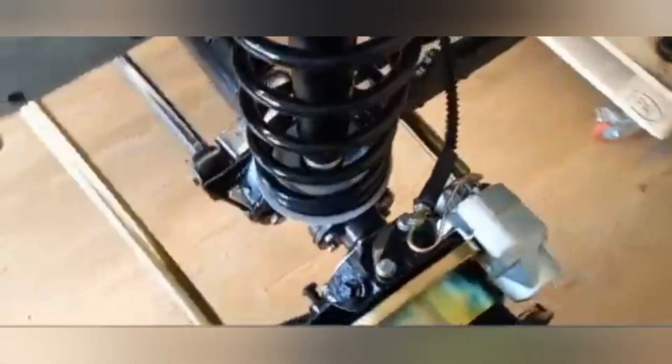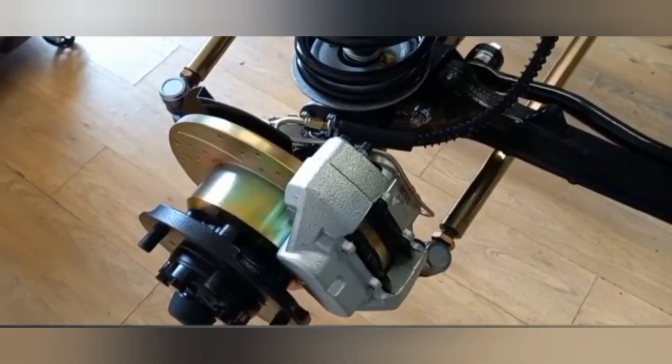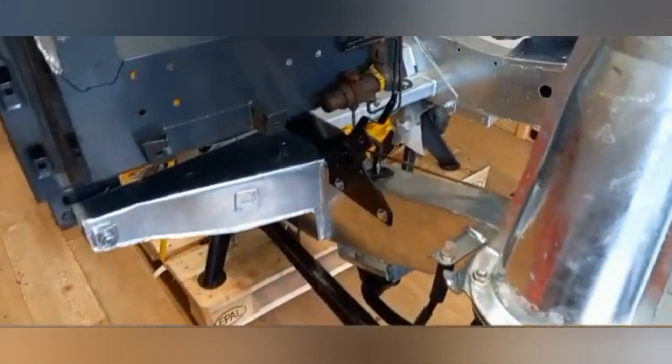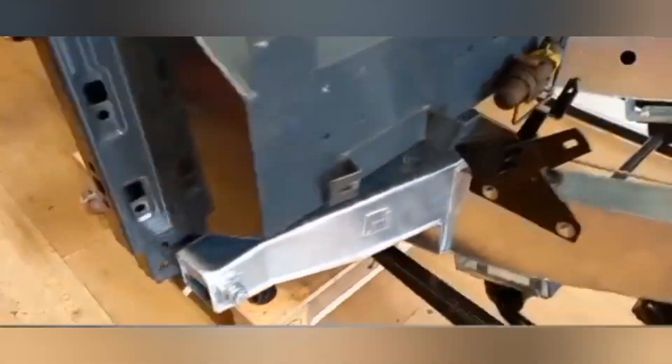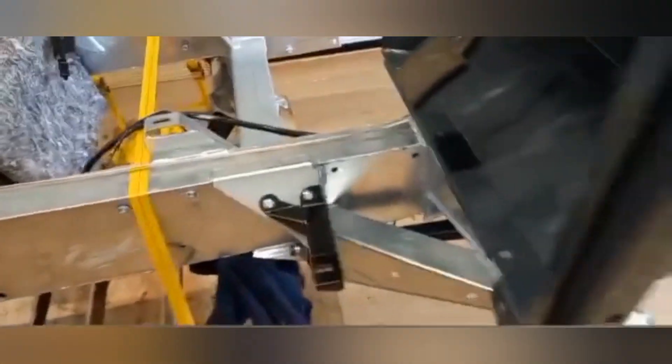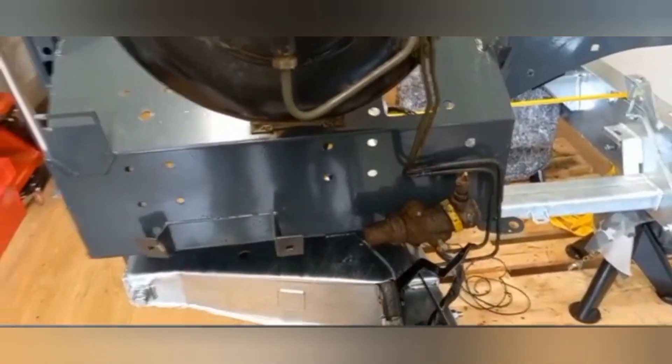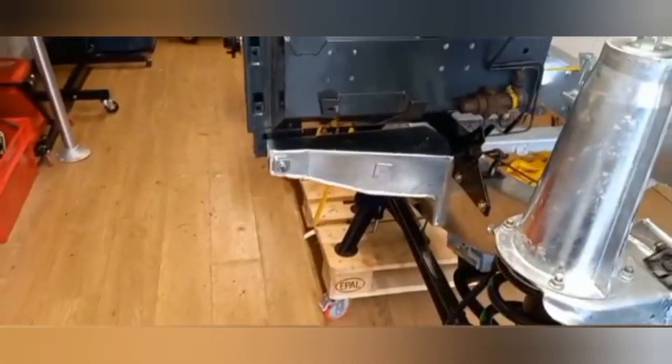A bit of a wind to get around, but that's them done — looks nice and neat. I'm just running one up through alongside the chassis at the moment. That's the new brake valve — identical to the one that's on there, but I think that one looks horrible and was a bit weepy. We're just going to run the brake pipe down the chassis. What I'm going to do now is disconnect and fit the new one so I can sort the pipes out and roughly get them in place.